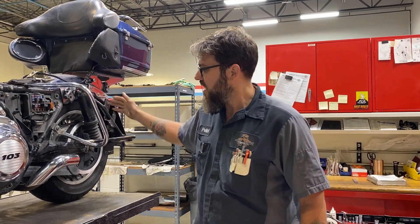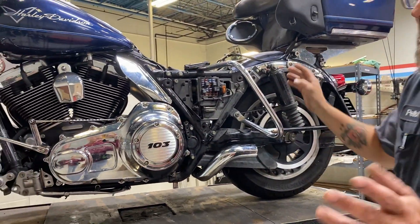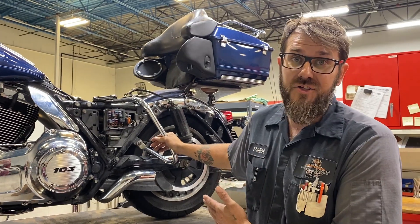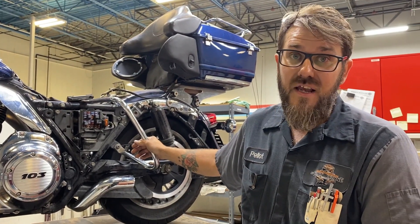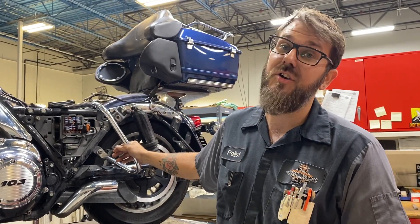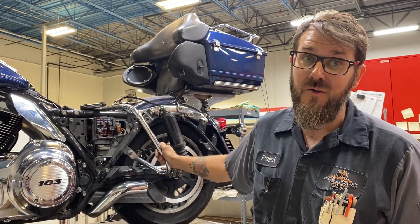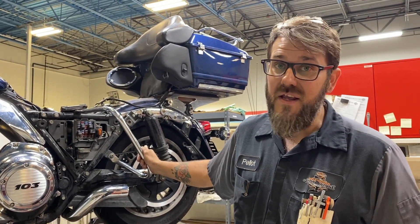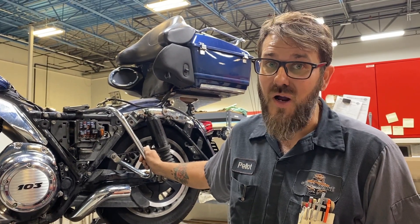Ironhead Josh here — we're going to finish up this segment. Toby's got to go help at the Three Rivers Festival. We got the primary bolted back on, we're bolting footboards up and getting ready for a test ride. A reminder: check belt deflection every time you maintain your motorcycle, every 5,000 miles — it'll save you a lot. You'll hear people say converting to a chain is cheaper — it is the first time, but you'll have to do it again in about 20,000 miles and every 20,000 miles after that. Belts last forever when maintained properly. Always follow your service manual.